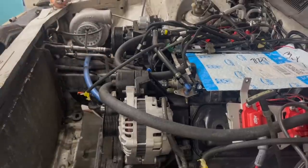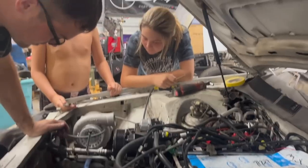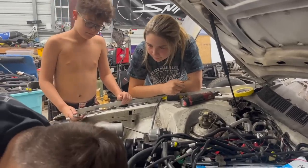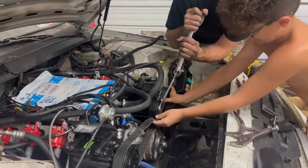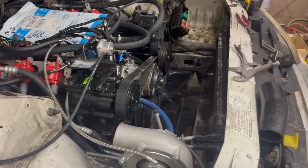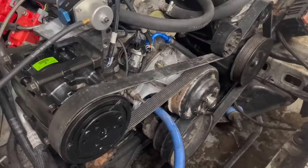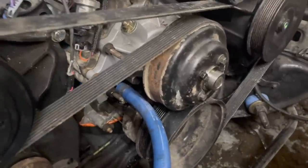There you go. So now the whole AC system's sealed up. It can't get any air or moisture in it. We can pull a vacuum down on it. Put it around here. Got it? Yeah. Look at that, the belt fits. Pretty sure that's the F-150 water pump pulley, but it looks like it's gonna work. And that rust on the pulley just helps it grip better.